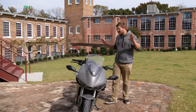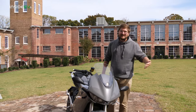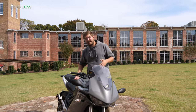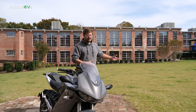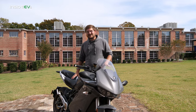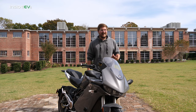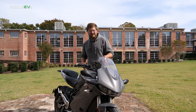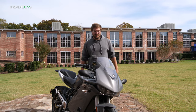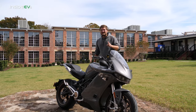Unlike a typical electric vehicle that gets its best range at 40–50 miles per hour, this bike loves stop-and-go traffic — it's much more affected by aerodynamics as a percentage than a regular full-size EV like a Model 3. Zero rates this bike at about 160 miles cruising around the city, and we can verify those results — we've normally seen 150 to 155 come up on the screen. However, as soon as we got it out on track it started predicting way less mileage.